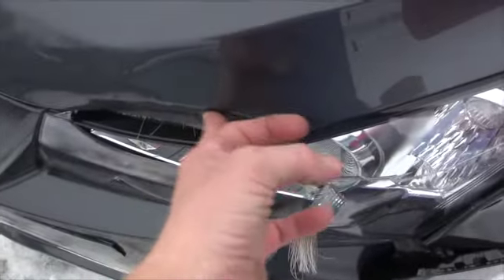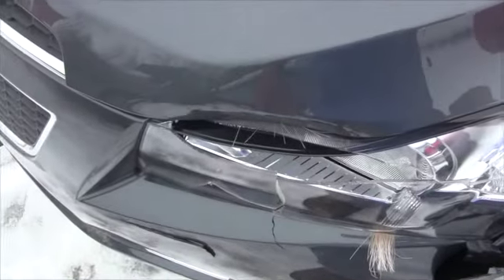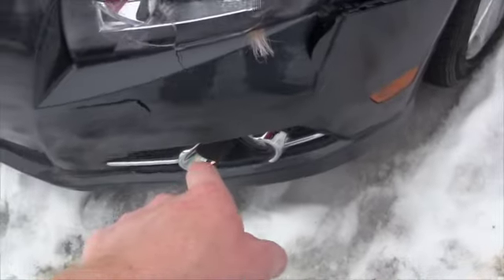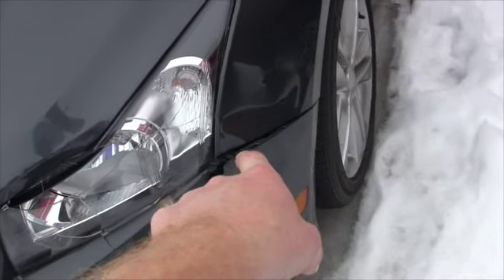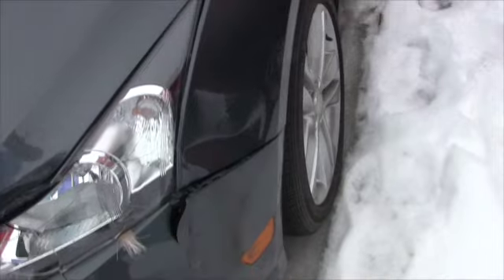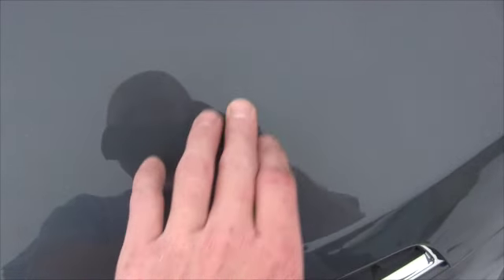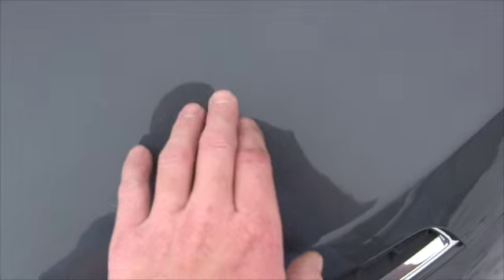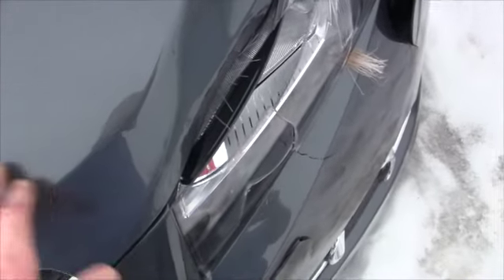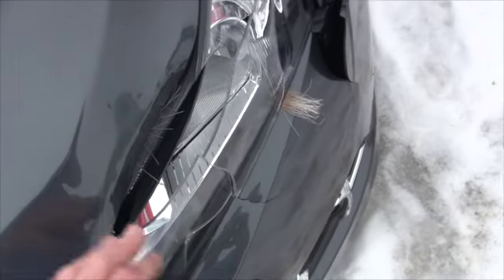I'm going to have to blend the hood anyway if I can fix this lip - otherwise it's getting a hood. Bumper cover. Headlight. The top fender clip is broken. It's got a boinger - it folded up right there. It's got a dent which is strange. I don't get that, unless at some point there was something under the hood and it got slammed on. But I wouldn't imagine so - this car isn't very old and it doesn't have hardly any miles on it.